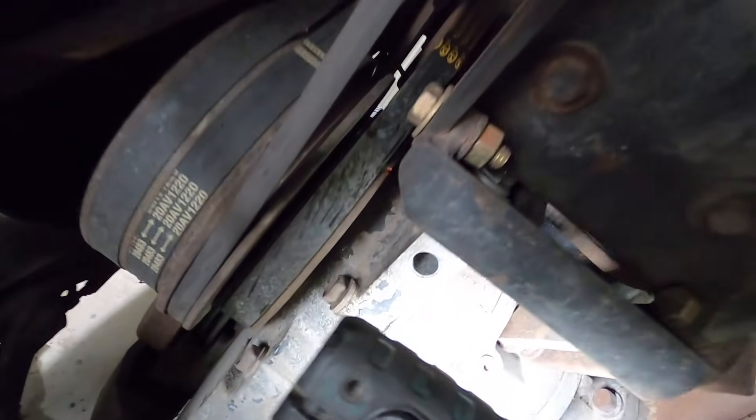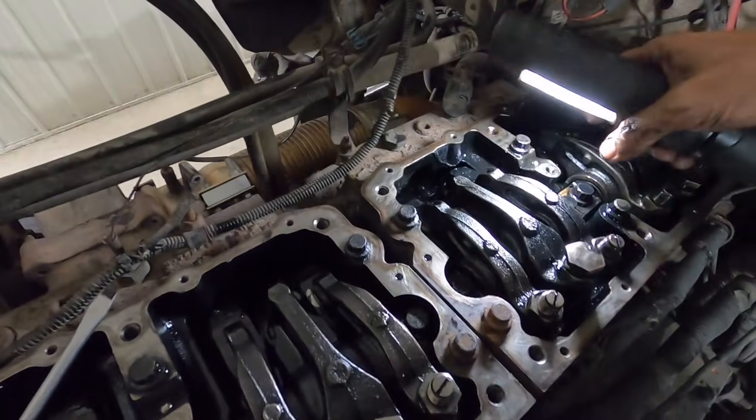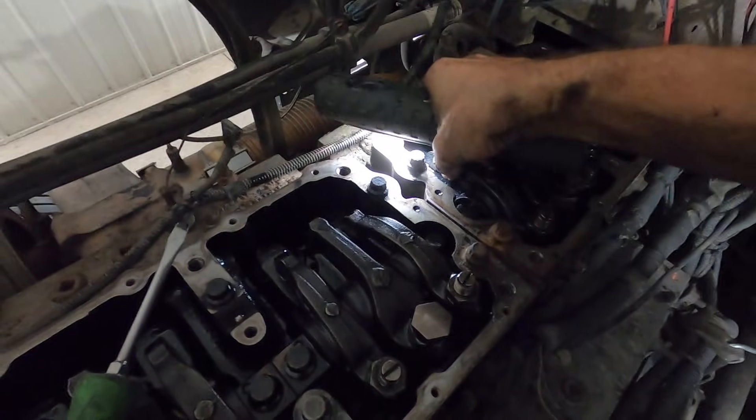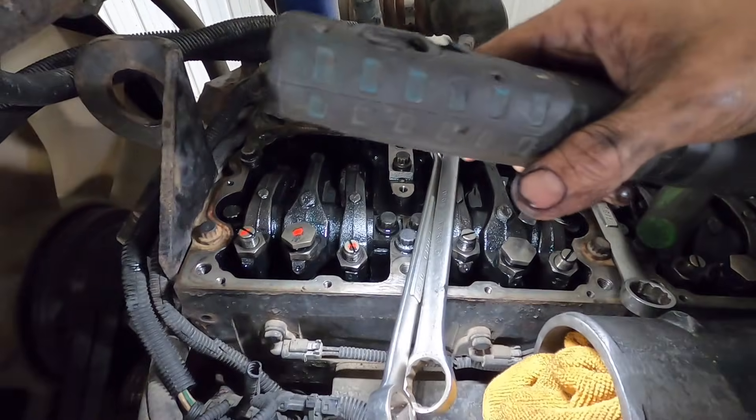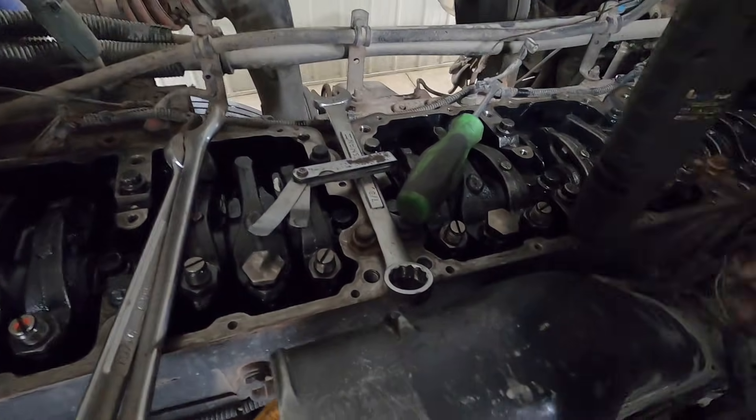I've barred my engine over to marking B — as in boy — and I can start on cylinder number five, because that's next in our firing order. I used a little paint marker just to reassure myself that I got those ones done. Keep moving on.